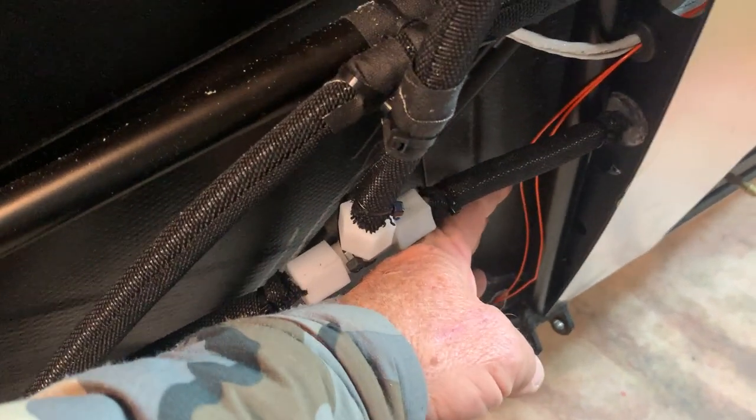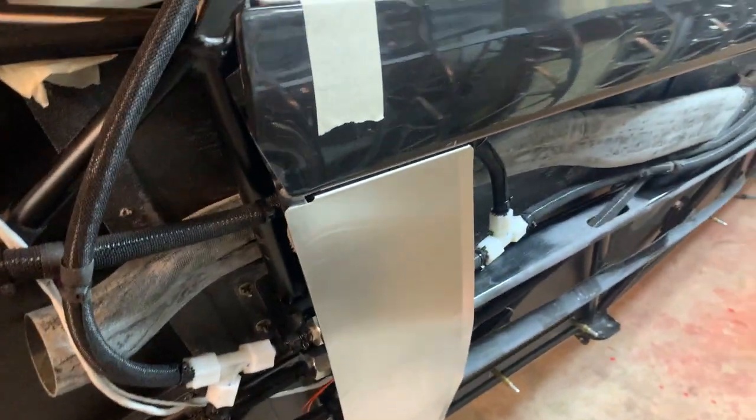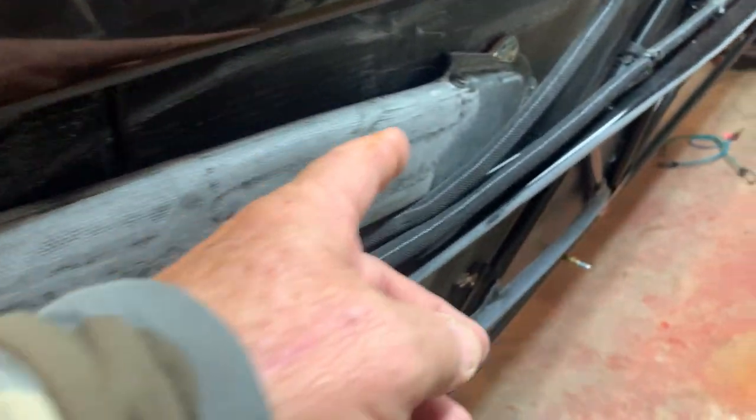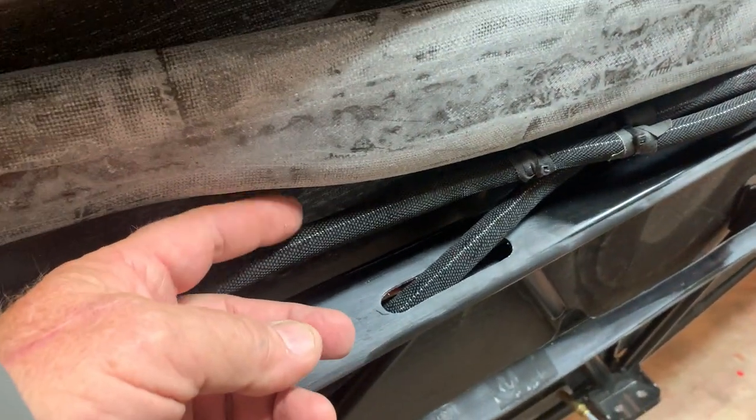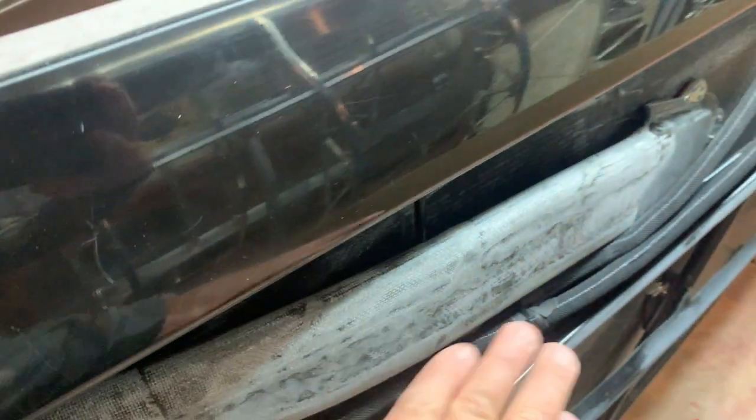This is sticking out because we've got this defroster coming through here, which is done separately now. This is a separate piece now instead of being molded into the fuselage like the early ones were. It made it kind of a pain getting this through when you're installing it through this gap, because you had to take the whole side panel and push it through. Now this goes on separately. Again, it goes over the top of this bar. There's a little bitty small tube coming through the fuselage from there to there. So this piece goes over that bar and then it goes down, and there's three screws that go there and connect on the inside later.